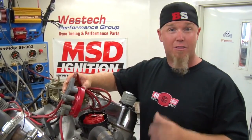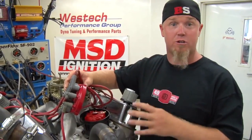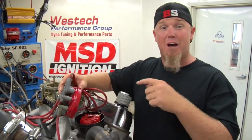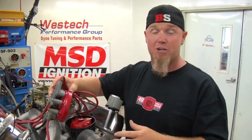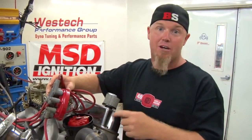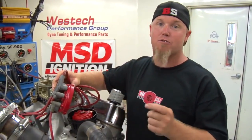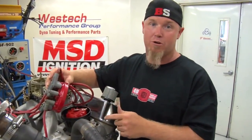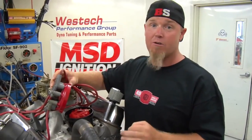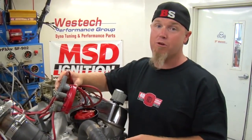There are a couple of reasons for that. The big thing is that with a traditional distributor you're talking about waiting for the crankshaft to start turning that energy to go through the timing chain, then into the timing gear on the camshaft, through the camshaft, through the gear set at the bottom of the distributor, and finally up to the rotor. Given that there's lash, slack in the chain, and crank twist, it's not going to be as accurate a timing system as you're going to get with a crank trigger.